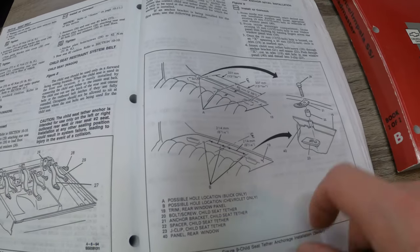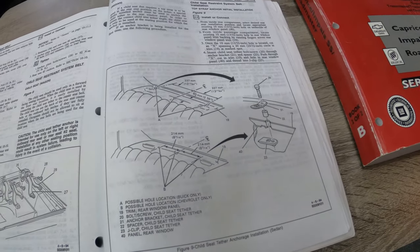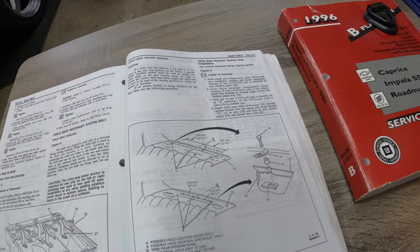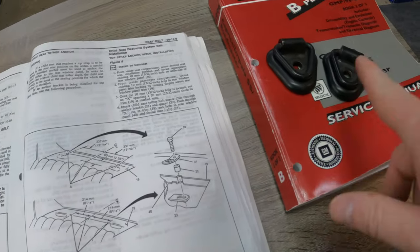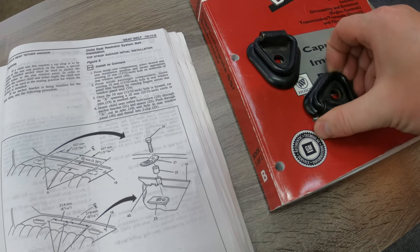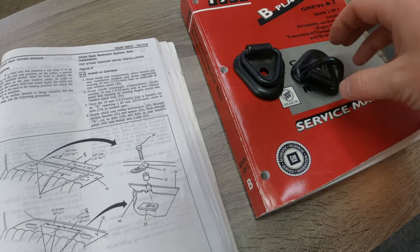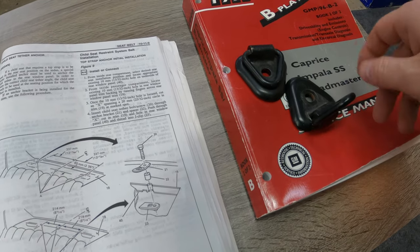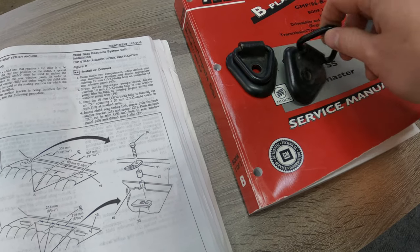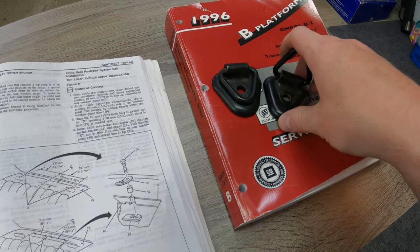I think this factory part is no longer around — if you have one I'd be curious to see it. When you get into cars this old, the safety standards on child seats change constantly. What I secured here are cargo straps — these are pretty common on a lot of cars, like in my Trailblazer in the back — and that's your third anchor point for the car seat. I was going to paint them gray and secure them there as a third anchor point so they'd almost blend in like factory, but I didn't get around to that since I only have one kid left in a third-anchor-style seat.